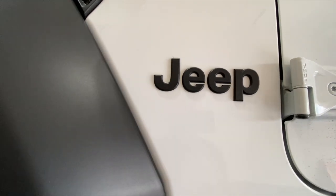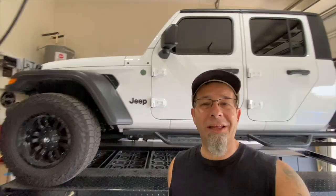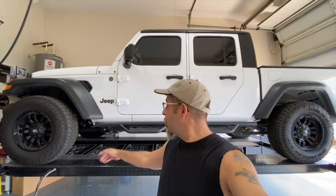Okay, that's it. It's amazing how simple it is to remove those decals with just a little bit of heat from a hairdryer. You saw that thing peeled off like it was put on yesterday, and this Jeep is over a year old — so the adhesive wasn't hard or overly sticky. Came off perfectly. There was no adhesive left on there; it all stayed on the sticker itself. Looks perfect — no scratches, no issues. In my opinion, the method I used in this video is the best way to do it. You should certainly never use anything abrasive on your truck. I've even seen people talk about using razor blades to get under the edge — unless you are really, really good with a razor blade, I would certainly never do that, because all you have to do is catch a little bit and you'll shave off some of that clear coat, and maybe even the paint itself. Highly do not recommend doing it that way.